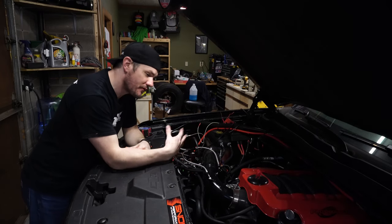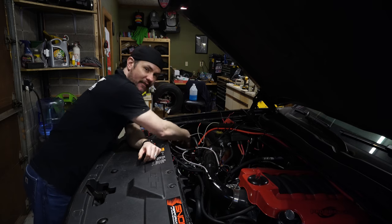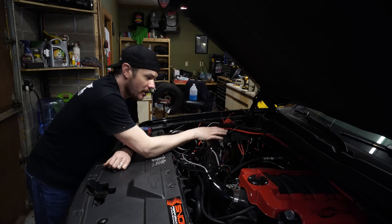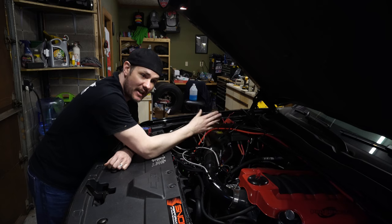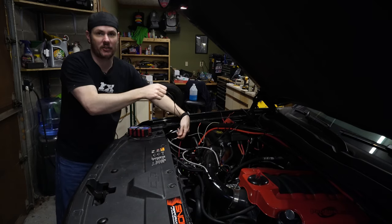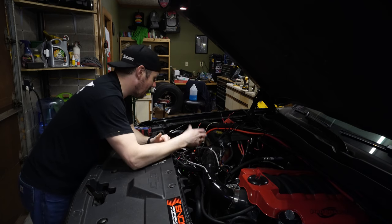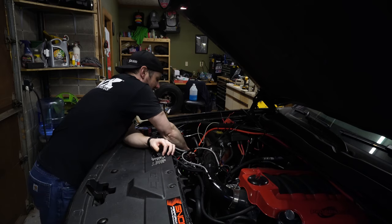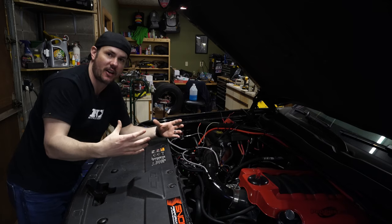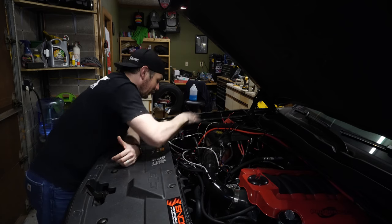Just basically how we specced it out on the bench. I've got my nozzles installed coming down to my T — it comes down from my pump outlet. On the inlet side, I've got the filter that comes up to the solenoid that actually shuts off the line from the trunk. All the line is lower, and in fact the tank is also lower, but they suggest that anytime you run the tank in the rear, go ahead and have the solenoid before the pump. This will be wired up along with the pump lead, so whenever the pump is active, the solenoid will be open. We had some excess tubing, and eventually we'll get fittings to cut these down to the proper length to clean up the installation. I did have to go in on the pump itself and build a couple of aluminum standoffs because the battery tray has a big hole in it — I basically bridged that hole so I could easily mount the pump down in there.